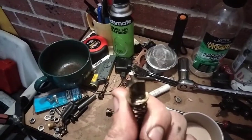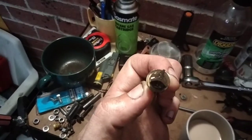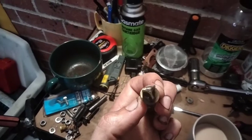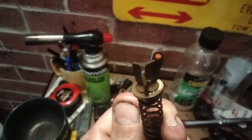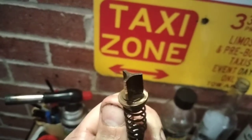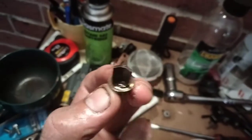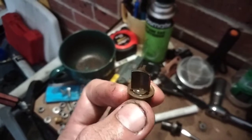Alright, back with tea. I hadn't cleaned this off, but I just ran it under a bit of alcohol — see how we're wearing a lot more on one side of that relief valve? That's because the piece of plastic was caught on this side. I'm pretty confident this is going to be the problem. It looks like it's just taken the finish off. Looking at this from the side it looks fine, but I'm a little nervous from what I've read online — this may need to be faced in a lathe. The easy thing to try would be to chuck this in a drill and very very gently run around that with a little bit of fine wet and dry.